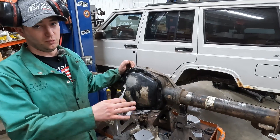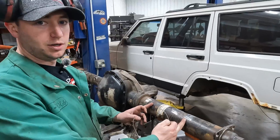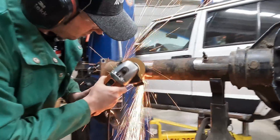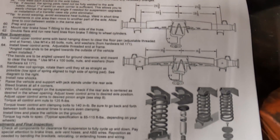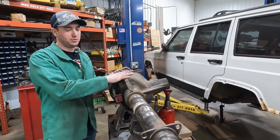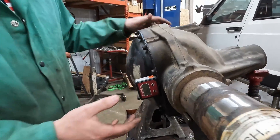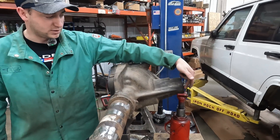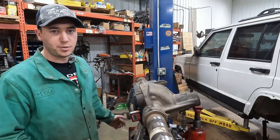I took some rough measurements just to kind of know where stuff was going to land. It's mostly all in this area, so I'm just going to clean it all up so we know it's clean and we've got enough room, then we'll get stuff tacked on. We're ready to start tacking our brackets on. Before we do any of that we have to set our pinion angle — which on lifts four to eight inches, instructions call for 14 degrees. You want to be on a mounting surface, either at the diff cover or on the flat surface where that pinion seal would go. 14 degrees is what we're looking for — 14 degrees is what we got. Ready to start getting our brackets tacked on.